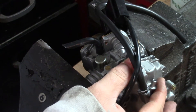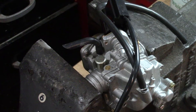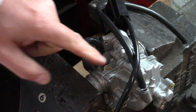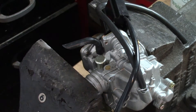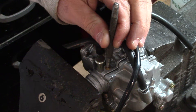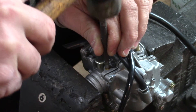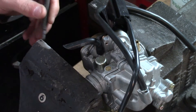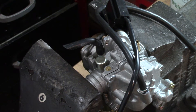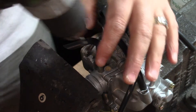I've loosened up the bowl. I'm just keeping this on here to stop dust, and right here is our high speed adjustment that you can adjust. So I'm going to use some left-handed drill bits and try and drill this thing out. I know there's going to be an adjustment screw under there, so I just want to be careful I don't go too deep. I'm thinking this should be easier to get out than the other ones because this looks like just a brass plug, where the other ones were some sort of harder metal. So I'm going to try my left-handed drill bit and we'll see if I can get this thing to drill and spin.